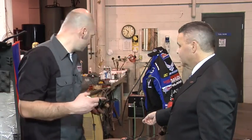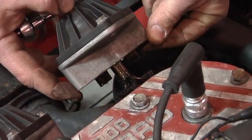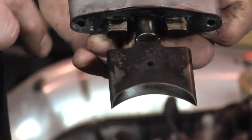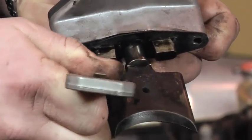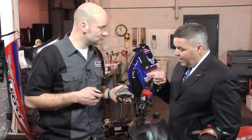Can we take a look at the valve off of this machine? Yeah, we sure can. So Len, what am I looking at here with this valve? Well, what we're looking at here is the start of a problem. If you take a look real closely at this particular valve, after we've wiped away the excess oil, you're looking at carbon deposits. And if we take a razor blade and scrape just a little, you can start to see the carbon forming on this valve. This sled runs okay right now, but it's not going to stay that way. And that's why it's so important to use a high-quality two-cycle oil like Amsoil Interceptor in a machine just like this. Interceptor is formulated specifically to fight this problem — it's not prone to depositing. You won't see any of this excessive carbon buildup like we're seeing on this valve.